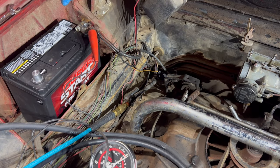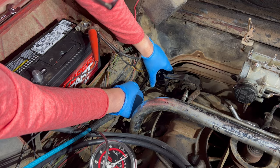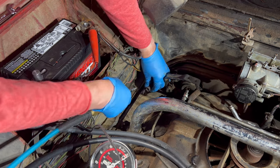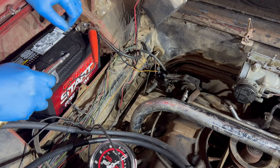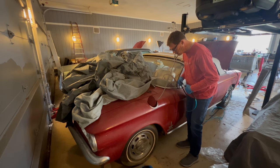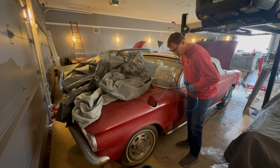Well, I mean, it's blowing air, but is it? It's leaking. Makes me wonder if it's obstructed. What I'd like to do is inject air into the fuel line while listening at the gas tank filler to see if I can hear air rushing into the tank.